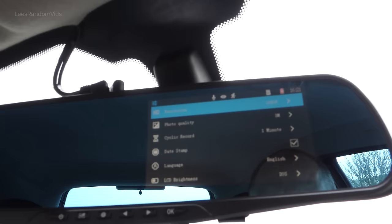Going back to what I said earlier — if you wanted to save space on your memory card and reduce the amount of protected files, you'd turn parking guard off. Go back to menu, stop it from recording, press menu, go down to parking guard, and if you tick that off it will no longer do that. I'll just demonstrate: with it turned off, if I bang on the windscreen it won't record. That is your parking guard. But I'd recommend you keep it turned on and just format your memory card every now and again to free up those protected files.